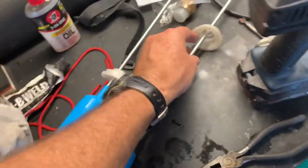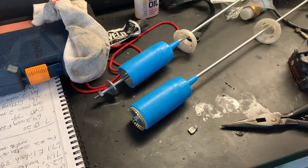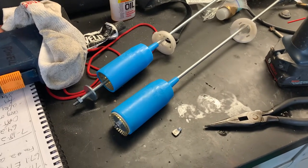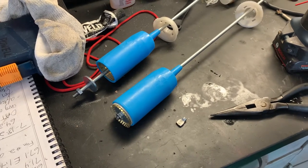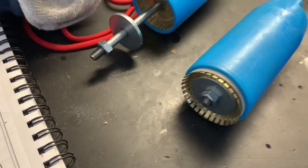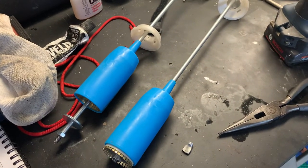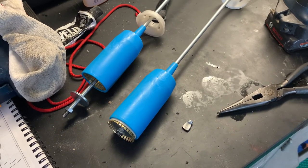This saves you money — the spring is probably six bucks, but these rods are $15 each. The red ones in the back, which I can't tell any difference from the front looking at the springs, are actually $72 each. So getting the same springs on all of them and just threading the rod when you need to replace these will be a good savings and something you can easily do. Thanks for watching.